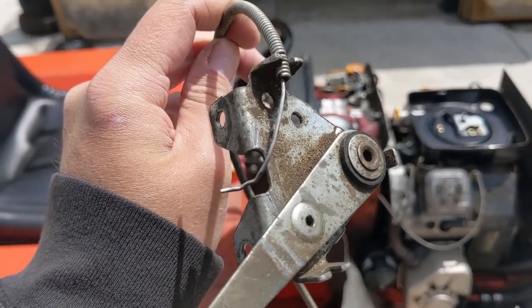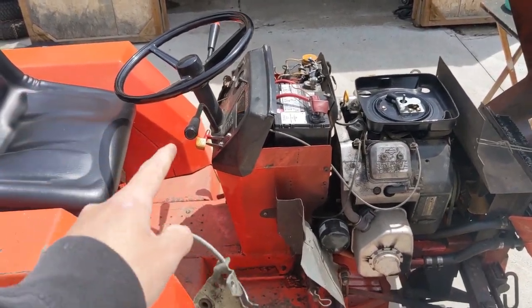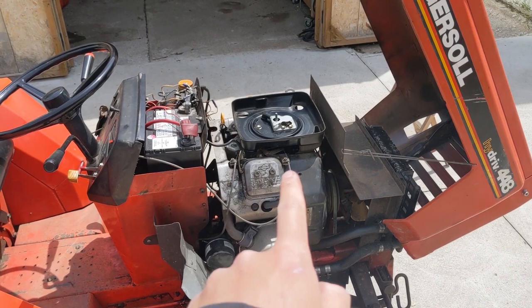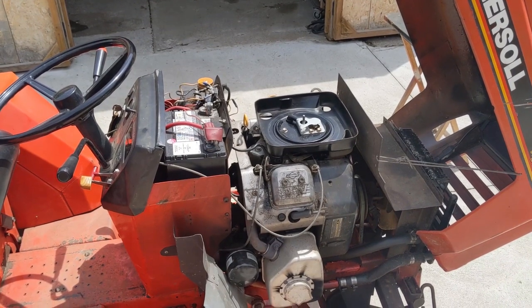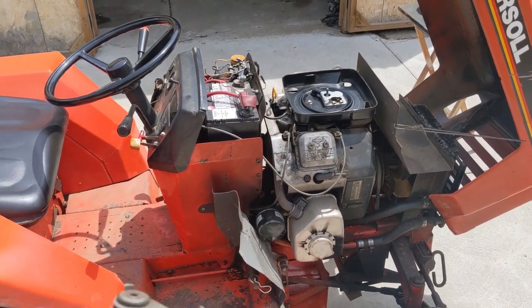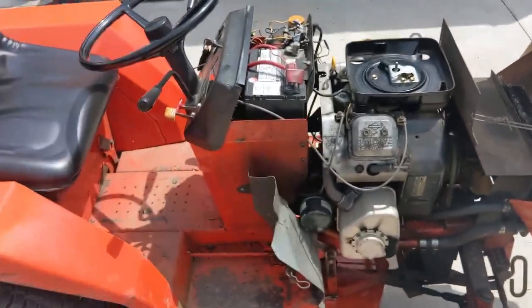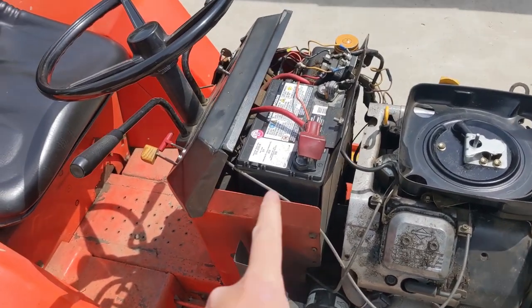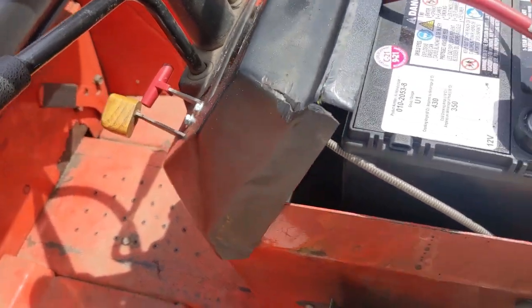Normally you have the cable and it goes to a z-bend to the control arm. The choke cable, even though it had some tension on it up here on the dash control, the choke plate itself was not moving. The choke was kind of stuck in the three-quarters closed position, which could lead to the engine running rough. So instead of just fixing the z-bend and reusing this choke lever assembly, I replaced the whole choke cable and lever assembly, because you have to remove the battery and it's very difficult to get into the choke lever area under there.